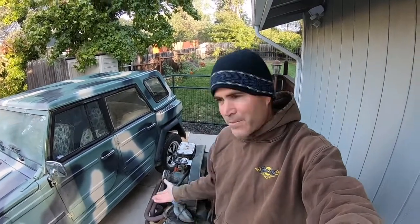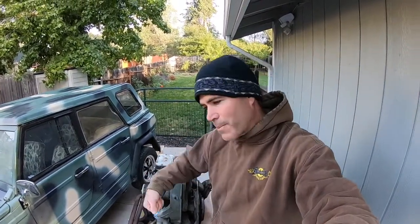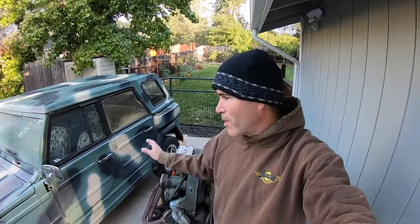All right, well, we finally got the engine out. Definitely took some maneuvering and jacking the back of the vehicle up a little bit further than I felt safe with. Ended up being slightly precarious, but I had the front wheels blocked and tried to keep it as safe as possible. Had to take the air filter off and even tip the back of the engine up and slide it out that way. But it's out, and next video I'll be going over preparing for the other engine to go in.